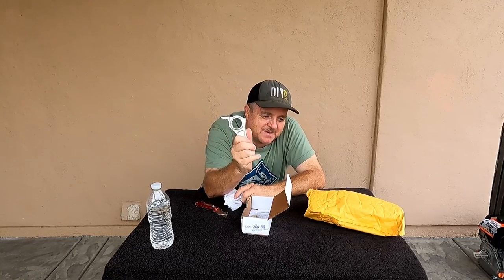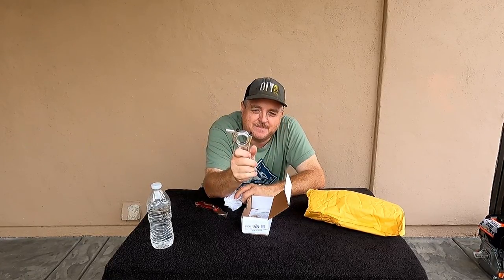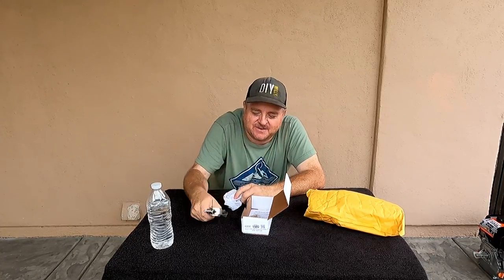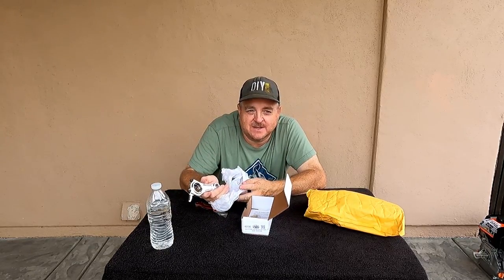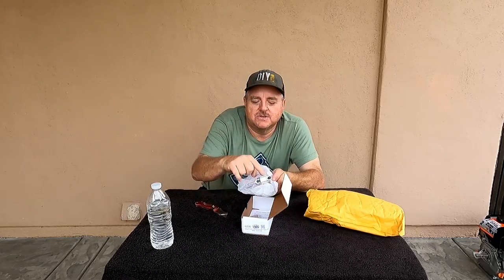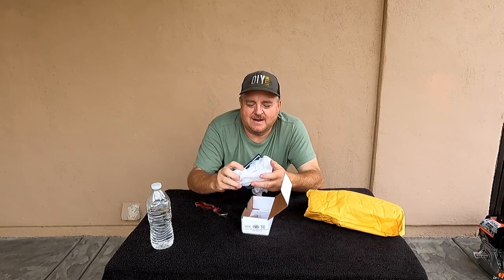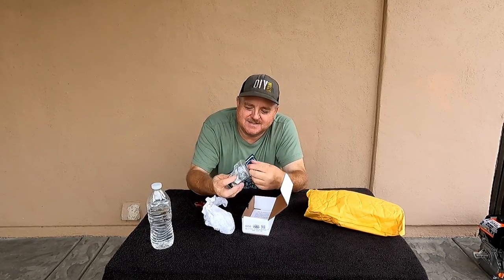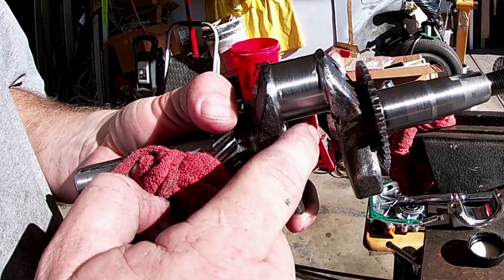And a little story behind these rods. When I built that engine the first time, I bought the wrong rod. And the rod was for a clone engine. And I guess the 212 and the clone engines are a separate engine. And when I bought the rod, I was thinking, well, it's a clone of a Honda, so it'll work. Well, it doesn't. The journal size here, the bearing anyway, is different. And I had hours upon hours upon hours of machining that bearing down with sandpaper to get it to fit on the crank. It just didn't fit. It wouldn't turn. If you've seen those videos, I'll leave a link in the description. If you've seen those videos, I built that engine really fast.